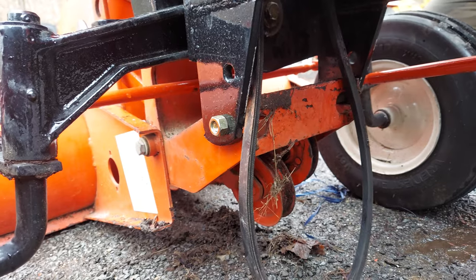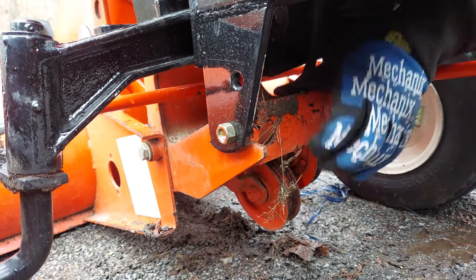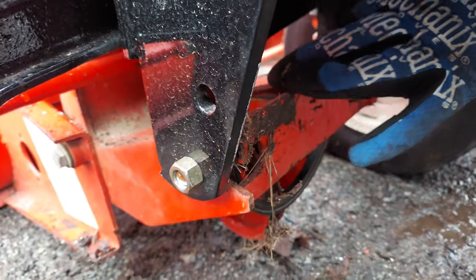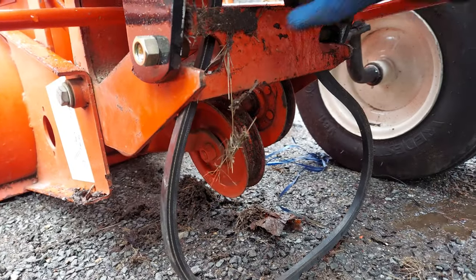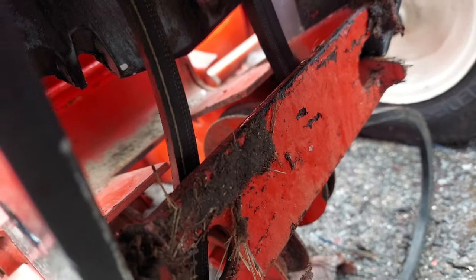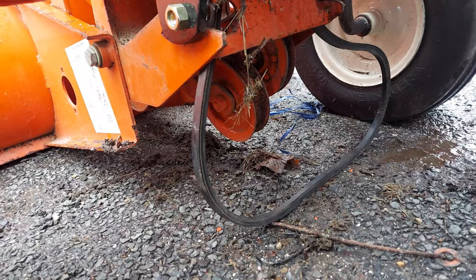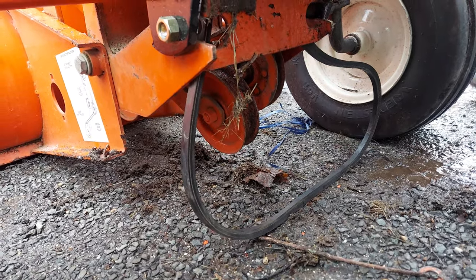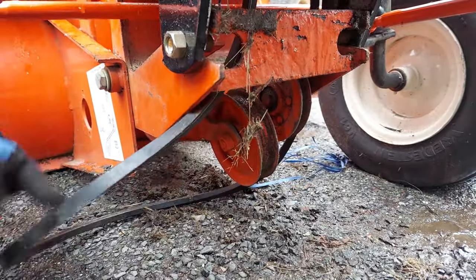just pull your belt up and then make sure it goes down in here. So you're behind the axle and into the mule drive, and then it's going to make its 90. But you have to make sure you're in here. You have to go back and forth if you don't have two people between putting it in the pulleys and the pulley up top and the pulley down below. And then pull this here, make sure it doesn't get twisted.